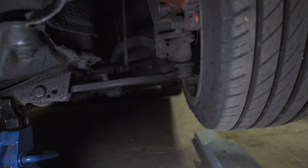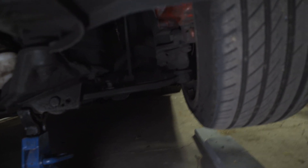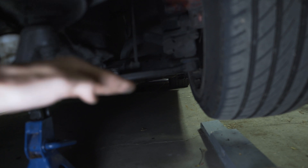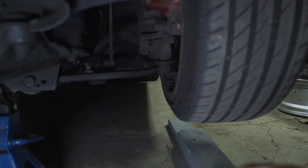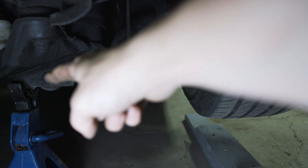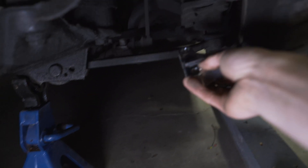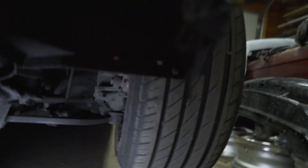What we're going to be doing - as you can see here, because my car is pretty low, the lower control arm right here is not flat. When the car is on it and the suspension is compressed, this point is actually higher than the other end. That's really not great for the suspension geometry, which is what these spacers correct.